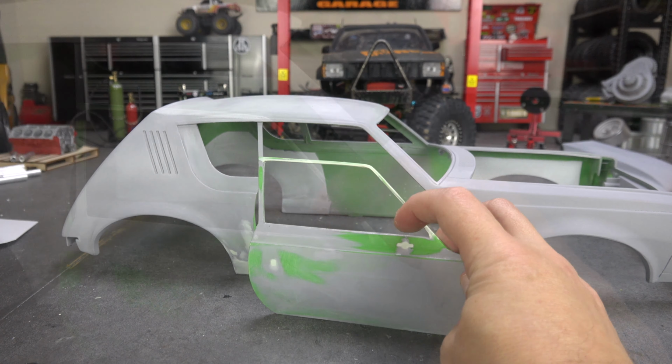Also worked on the rocker panel. So I finished building out these body lines at the bottom here. I think I've got them real close. I've got to prime it yet. I'll do that later this evening, but finished smoothing out the frame rail itself. So now all the pits and whatnot are gone. Got that taken care of.